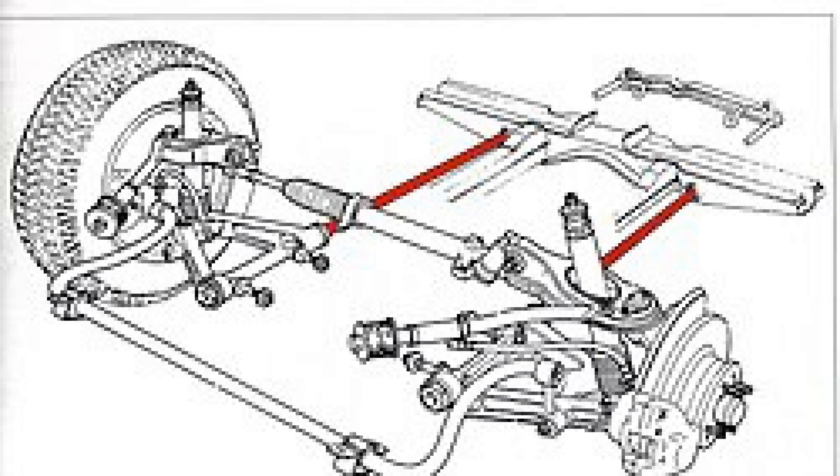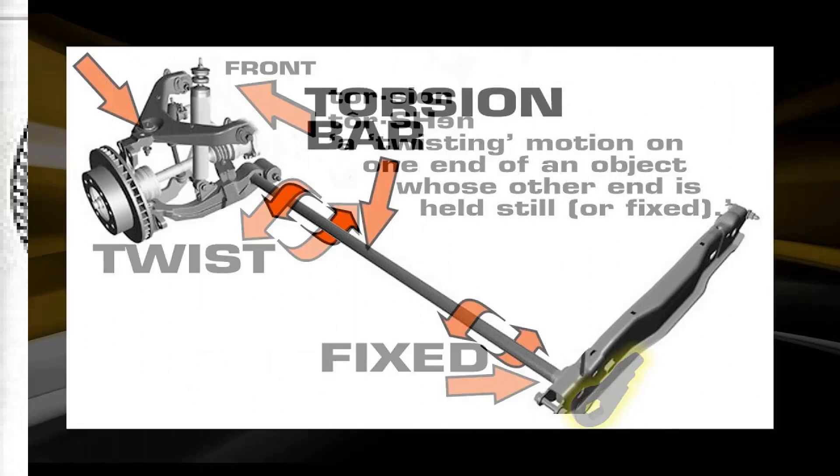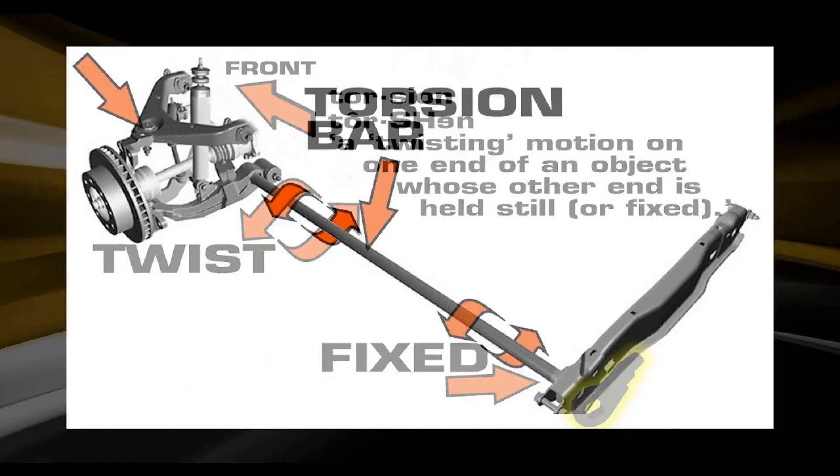Torsions are more often round or square bars, or more rarely made of several plates of spring steel, similar to springs but working on torsion. Round rods at one end usually have a spline knurling for attaching them to the levers, and for attaching to the supporting element — frame or body — the other end has either splines or a profile different from the round. The section with spline knurling for a more secure attachment is usually made larger in diameter than the main rod. Torsion bar suspension can be independent or semi-independent, as shown in the photo.